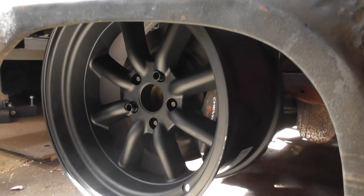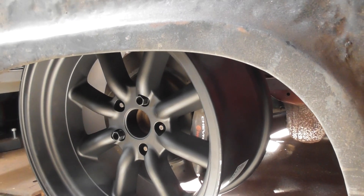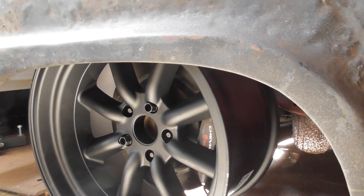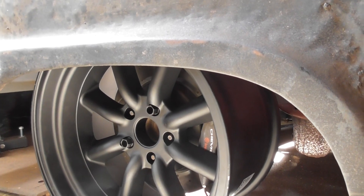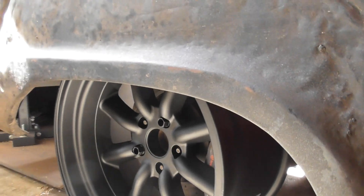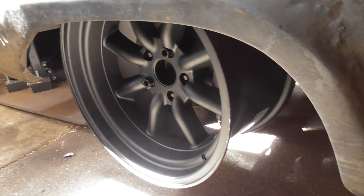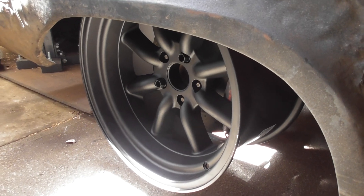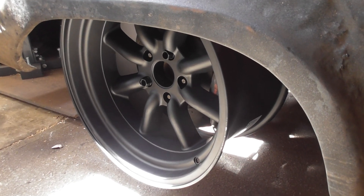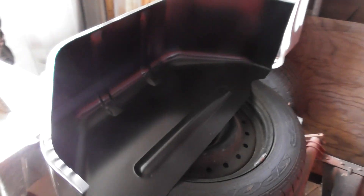Fits really well, but it's a little bit tight on the caliper. It'll probably require a 5mm spacer on the wheel hub just to knock it out a fraction and give it that little bit of extra clearance. Really like that. Again, these will be painted silver with the Savvy Motorsport wheel nuts — all good quality stuff.